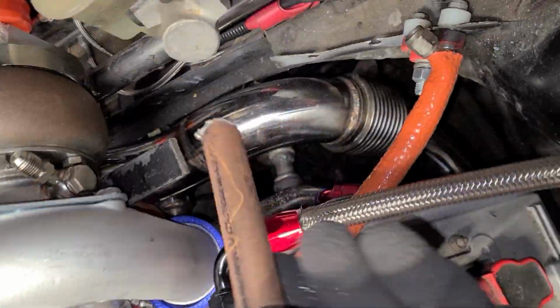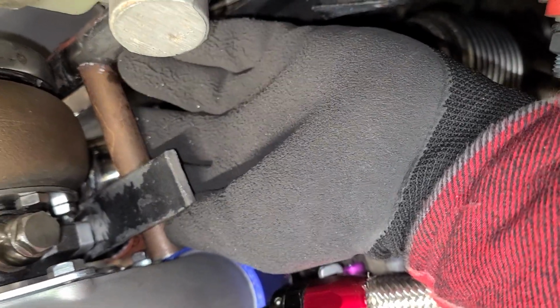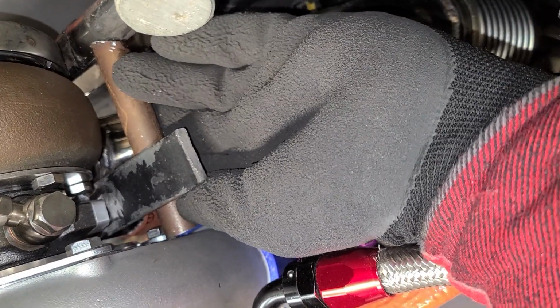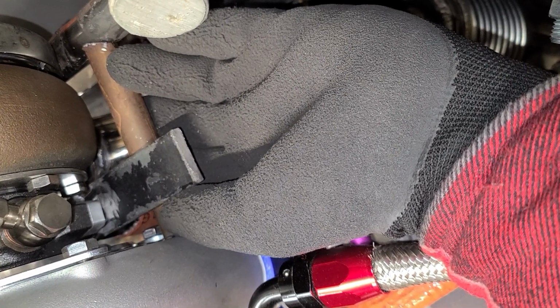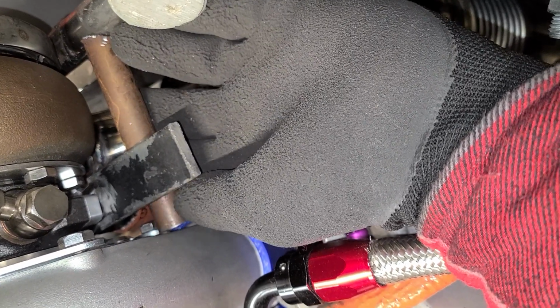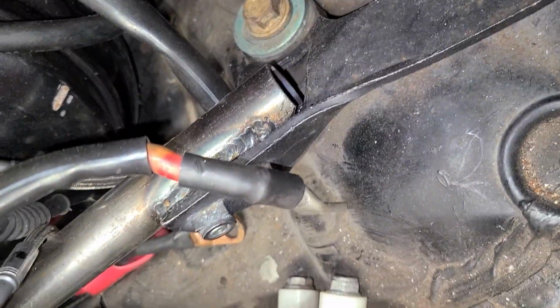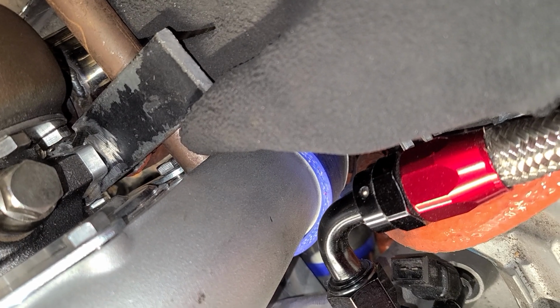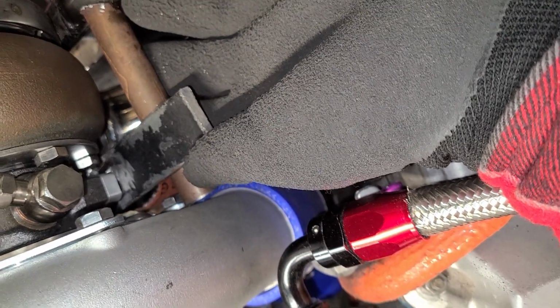That's a piece that's cut off. Where this is going, as it's going to sit here, and there will be two pieces, one on each side, and this will be notched. I'll cut this off, not really cut it completely off. I'm going to slot a gap in the middle, and then this plate is going to sit in this tube and be welded to the bar, and it's going to support the weight of the turbo. And yes, there is flexibility in that it's not really bolted to the turbo, so if it wants to move for contracting purposes, it will have all of that function.